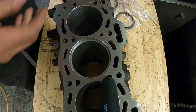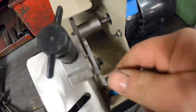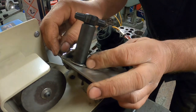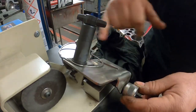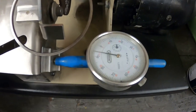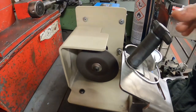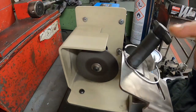That's a little bit too tight, so this one needs opening up a little bit. We take the ring out and this part of the machine is what you use to square the face of the ring. Get the ring sitting nice and square — you look for a shadow on this back edge — and flick that back. Move this knob back, because that controls how much you're going to take off the ring. Move it back away from zero so the ring isn't touching the stone. Switch the machine on and carefully bring the ring to the stone and just reset the zero.